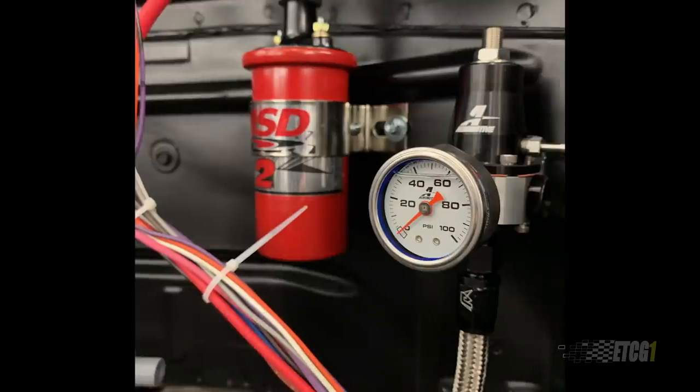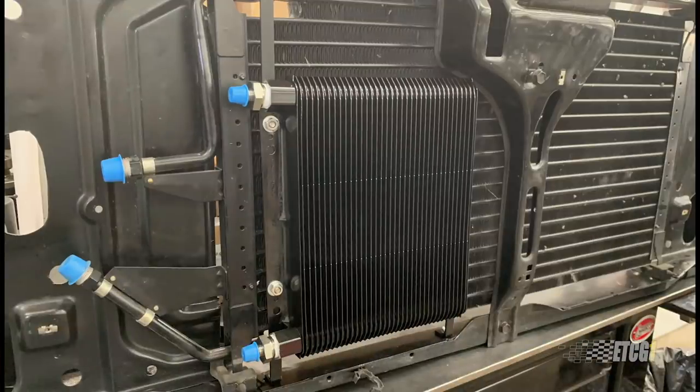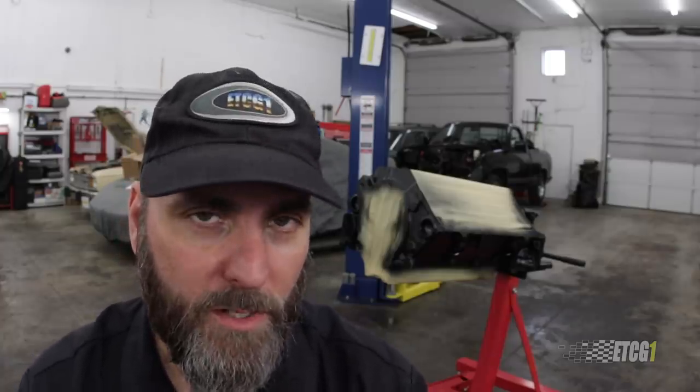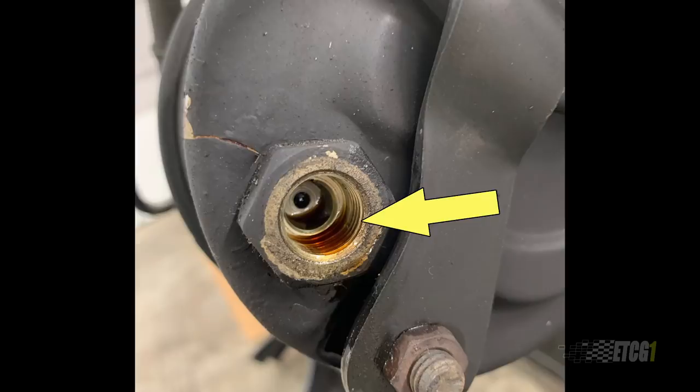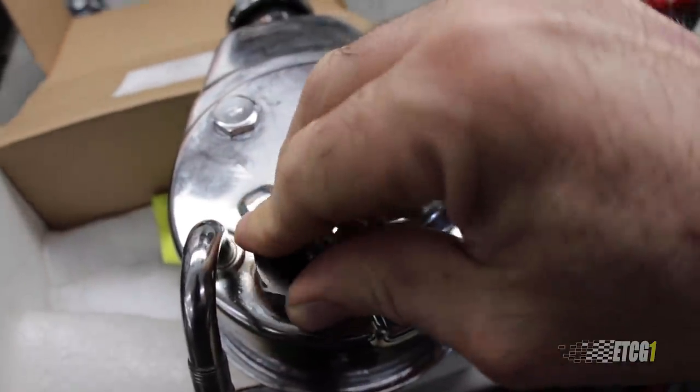So I'm sitting there one night — this is what I've been doing — taking pictures of the build as I go, and at night obsessing over them, flipping through just before I fall asleep, looking at things from a different perspective. It's actually come in handy because I've looked at something I did and from the photograph gone, I didn't see that in the moment but I see it now. Flipping through the power steering pump pictures I took — comparing the backs of both pumps where the high pressure line goes in — I noticed on the back of the Saginaw pump there's something that looks like a nut, something you can unscrew and screw something else in. It makes perfect sense because that Saginaw pump is in a lot of different applications — all they'd have to do is change that fitting. And it turns out I was right. I came in the next day, removed it from the old pump, cleaned it up, removed the one from the new pump, swapped them over, and away I go.